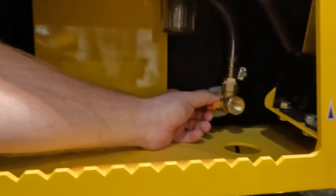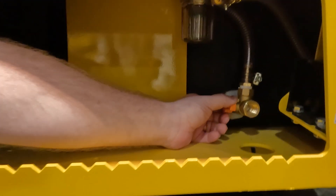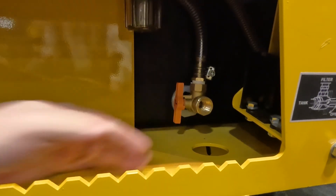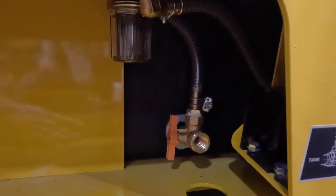If you're in the Northeast market, we have these drains for winterization. All you have to do is turn the valve, install a brass nipple and a hose, and run that into some RV antifreeze. You can suck that through the system with the current pump. Once you have some of that go through the drum, turn it off and you have a winterized machine — very simple.